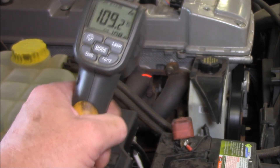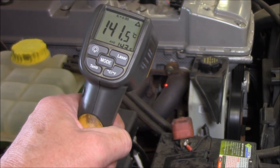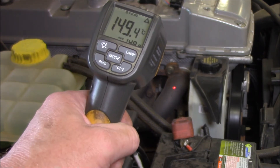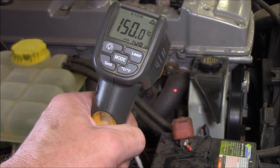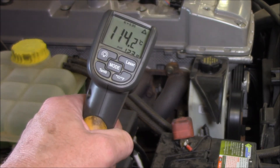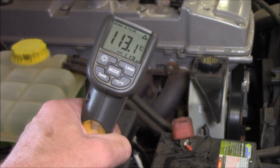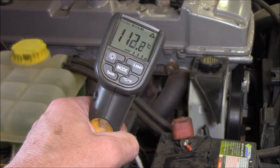Whereas back over here again, we can see that our average is 146, 145, right down in the bottom there. This one's firing because the heat produced by the combustion process is making the exhaust hot as well. We go to this one over here — not so much — because we're not getting a combustion process taking place. Therefore, the exhaust is actually a lot colder than the other one.